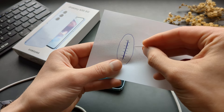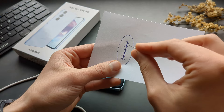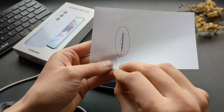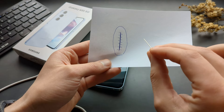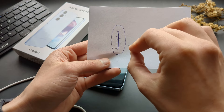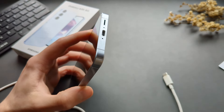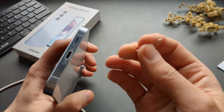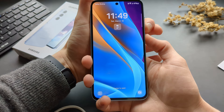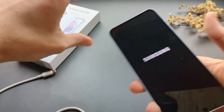Make sure you keep along only the outer edges — don't try to go near the middle as it's very easy to damage the pins. On one side and the other side, don't try to clean the ends because there's not a lot of space and you can damage something. Only work along the two outer edges. You can also get another person to shine a light so you can see better.